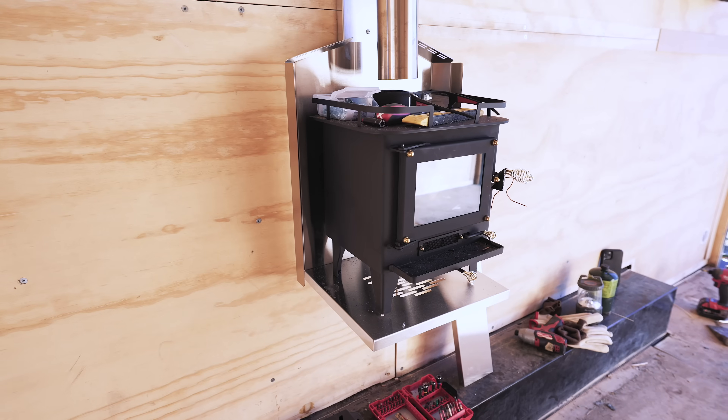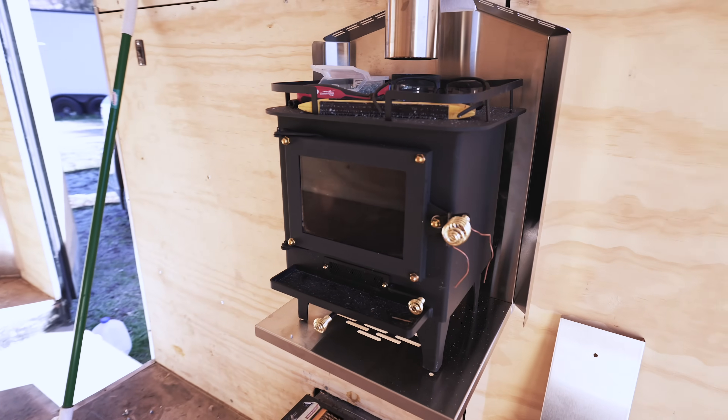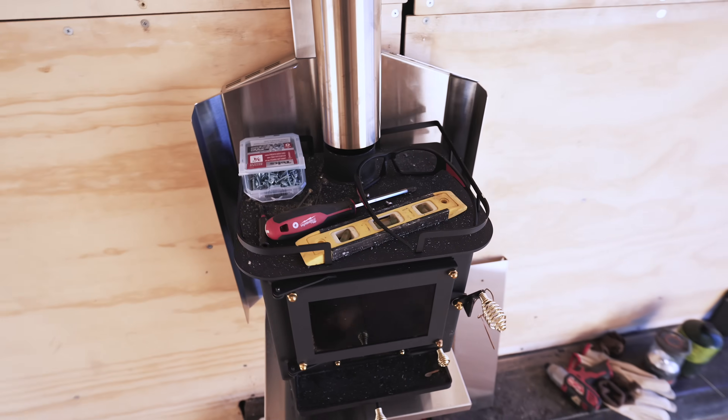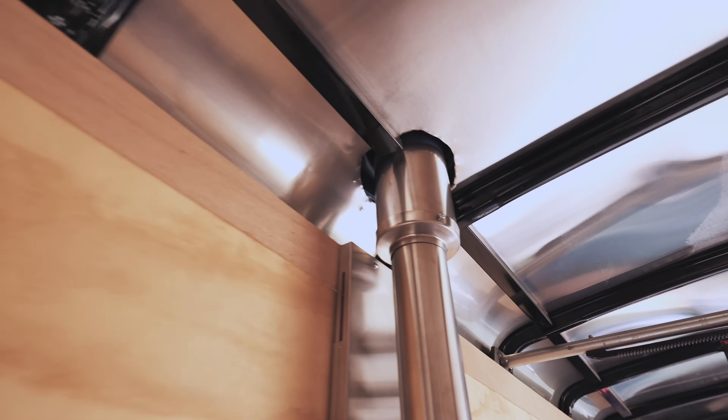What I really wanted was for late season — no real difference than my teepee setup — an enclosed shelter with solid heat inside, wood stove, comfort, dry out my gear, a little fan to keep the air moving, plenty of space to sleep and store gear, be organized. So step one, I decided to get this Cubic Mini Grizzly wood stove right here. You see this in a lot of van builds and cargo trailer builds — it puts out a crazy amount of heat. It's got a little heat shield that goes around it. I drilled a hole in the ceiling and added the heat shielding. It has a fresh air intake from the outside that pulls cool air in through a two-inch hose out the sidewall, underneath the stove.